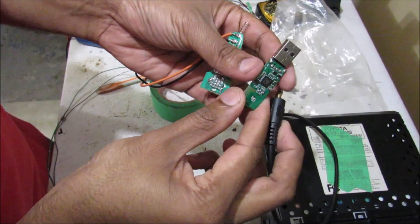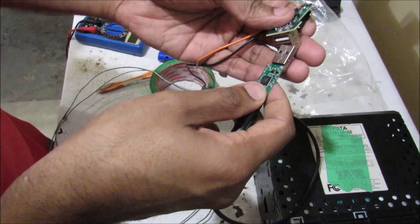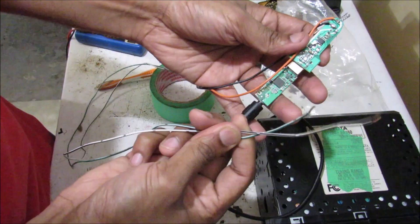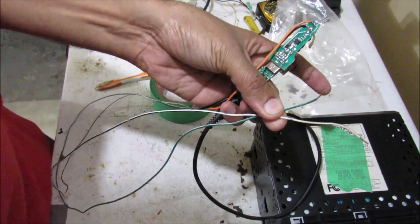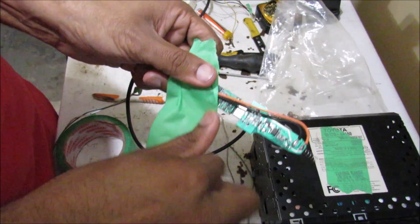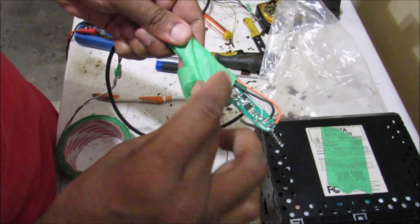To make the Bluetooth connection, take the Bluetooth adapter and plug it into the auxiliary line, then take the USB part and plug it into the power inverter. The two power lines — which I've extended — will go to a 12-volt power source behind the dashboard. To insulate the circuit board from touching anything behind the dashboard, I'm running tape around the whole thing. You could put this in a project box, but I'm just mocking it up for now.